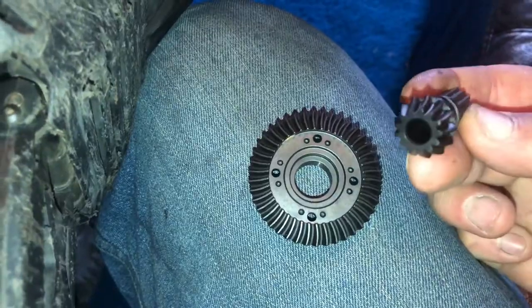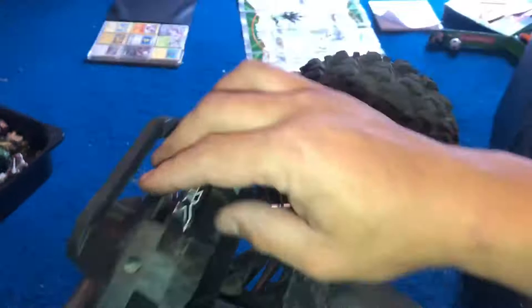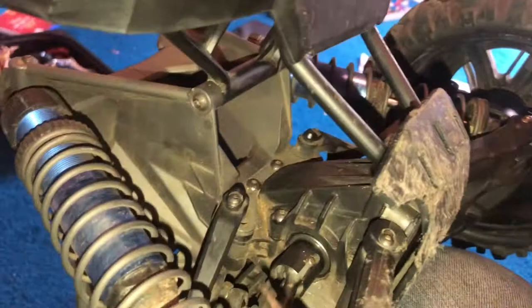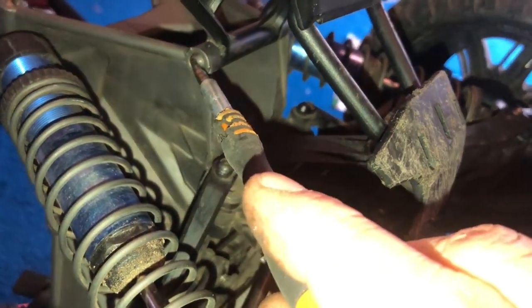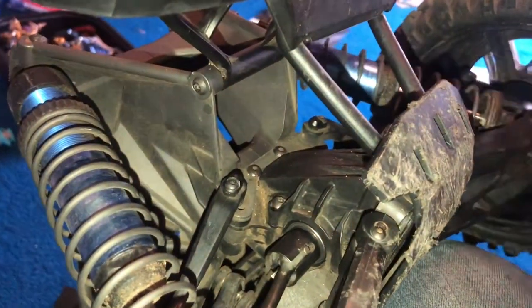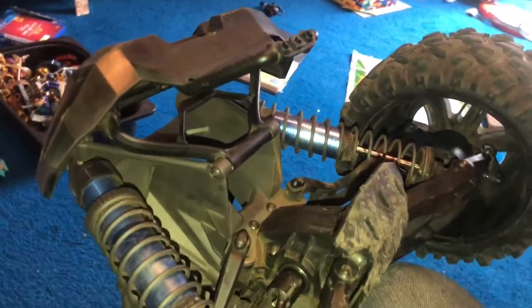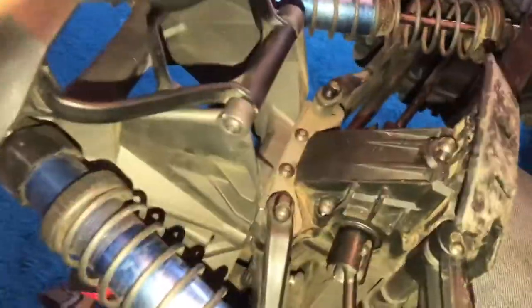That's the pinion. So what you want to do, you have to undo the bumper bar. It's just two screws — one goes here, the other one goes there. I already removed them. And then you just slightly undo this one and the same one on the other side, so that you can flip the bumper bar over. You don't have to remove the bumper bar completely, you just flip it out of the way.